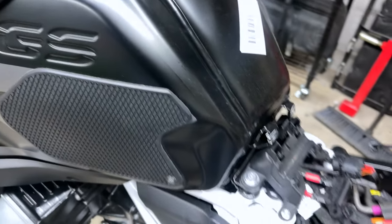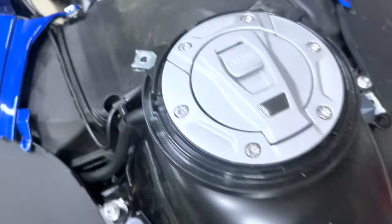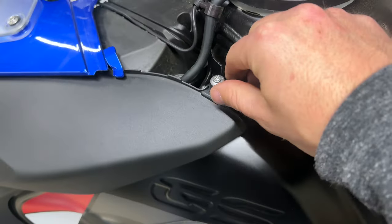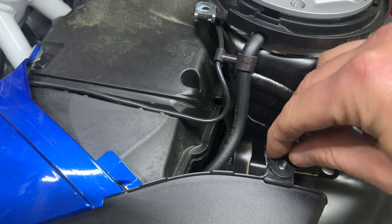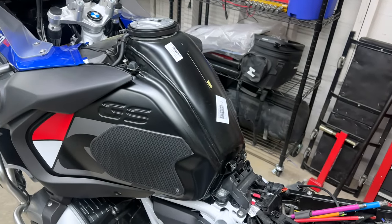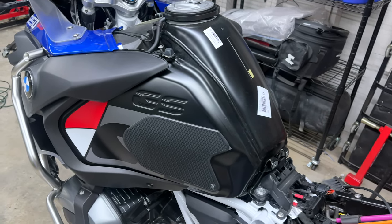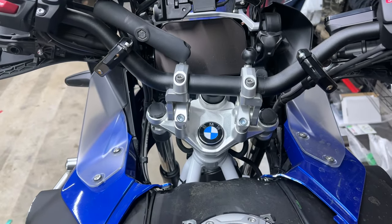One pro tip: as you're unscrewing things, look at these clips and push them all back flush. They will be off a little bit, so push these all back so they are flush all the way plugged in. Also, as you remove things, put that bolt back where you found it — just give it a couple of turns. Putting bolts back where you found them makes reassembly much easier. You won't be wondering if it's the right length. To get the T30 out, you might have to loosen up your handlebars to get down to that hole — I did because I have risers on.